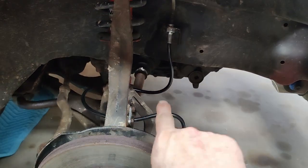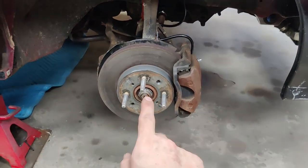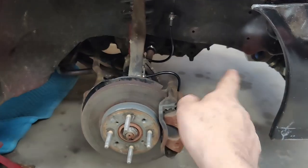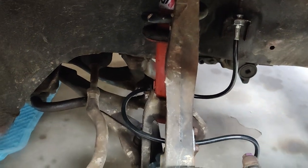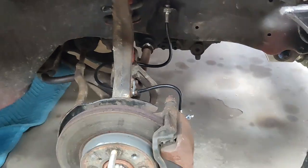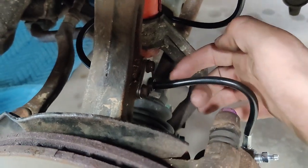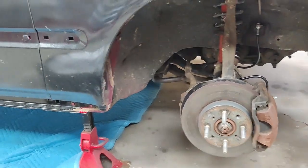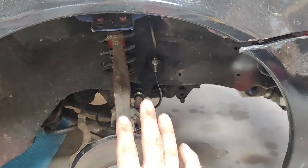You have to be careful because with this much line traveling in quite a few directions, you've got to watch for the wheel rubbing on it. What I did was put the wheel back on both sides, had somebody get in the car, and cycle the steering wheel lock to lock to make sure nothing was rubbing or binding. I had a problem on the driver's side but fixed it. These brackets aren't fixed at a set location — you can move the line through the bracket. I know it won't bind when the suspension droops because on jack stands with suspension all the way down there's no binding at all.